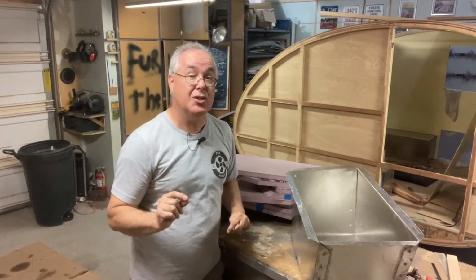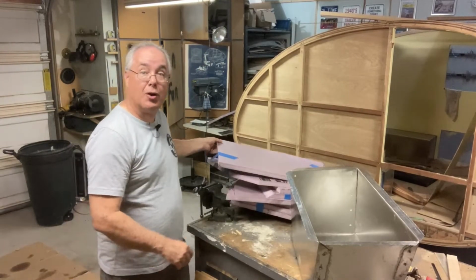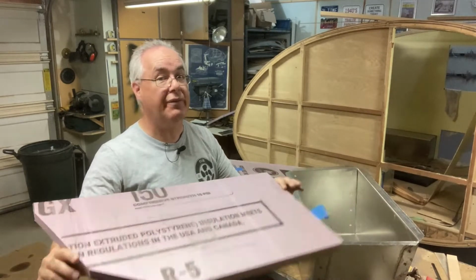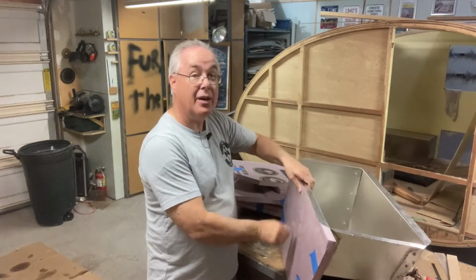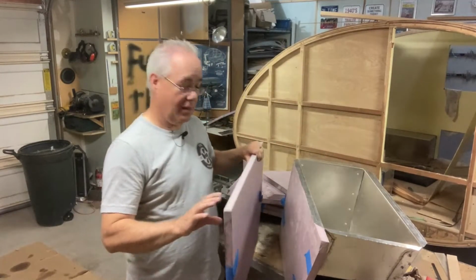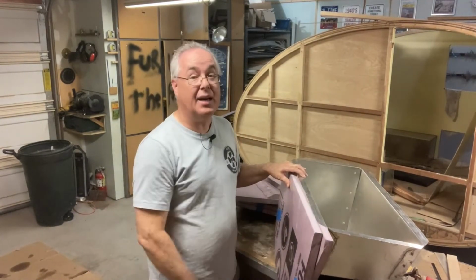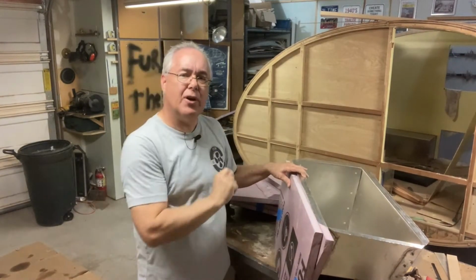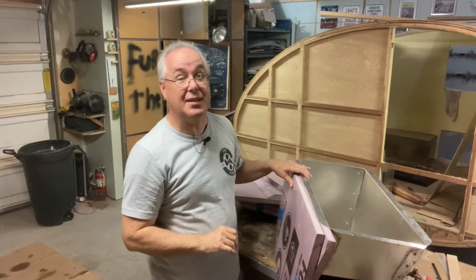Following the same insulation principles as was done before, we are going to use a modern insulation, this 1 inch thick styrofoam. We will be adding not only 1 inch, we are gonna add 2 inches thick of insulation for our Icebox. We have the room inside of our little kitchenette area, so let's go ahead and use it for that little extra insulating value.